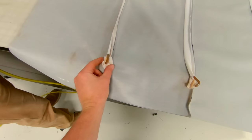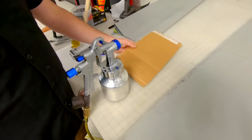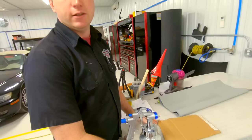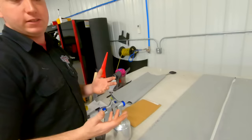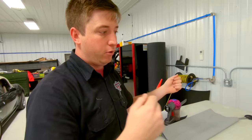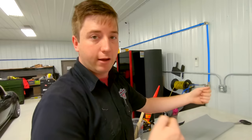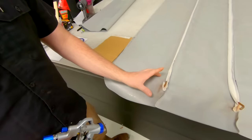The four bows are in and we've cut the extra around there for access. What are we doing here now? So the next step I like to do is — even though this is a staple-in headliner — I like to use a contact adhesive. We'll spray the headliner and spray that, and what that ends up doing is it saves us time when we're putting it in. We can adjust it, pull it down and remove it instead of stapling all the way across and realizing at the end you need to stretch it another two inches.